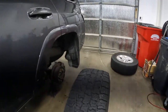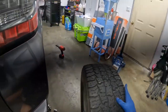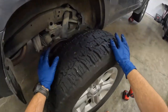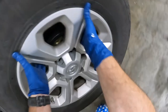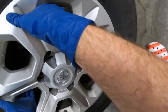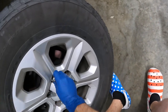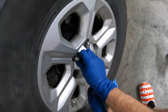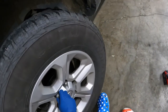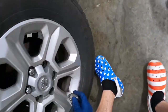If I don't sit here and try to explain everything, I can have this process done in 20 minutes. Always hand-thread these first. I know some people like to try to run them in with the impact - don't. Especially these wheels and lug nuts, for whatever reason, they're kind of a big pain to start.